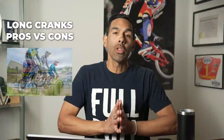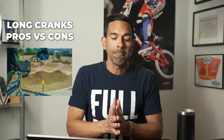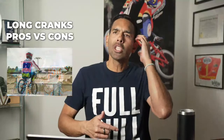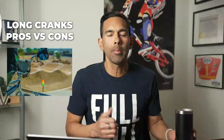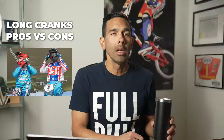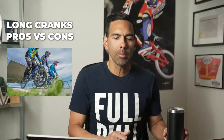After that, that's where the cons start to come into play. The crank is going to feel like more of a straight up and down chop motion. So imagine going longer than what you have now. I want you guys to think about a crank 5 millimeters longer than what you're running now. So for me, I run 177, that means I'd be running a 182. What are the pros and cons to that? That's how I want you guys to be interpreting this.